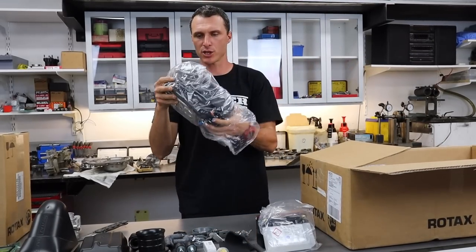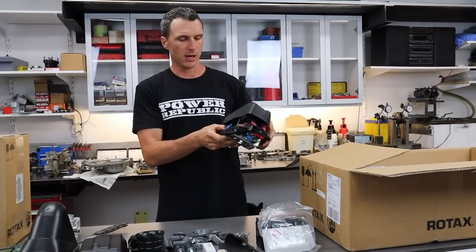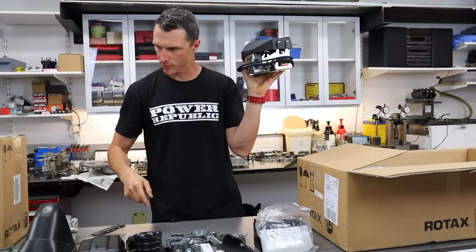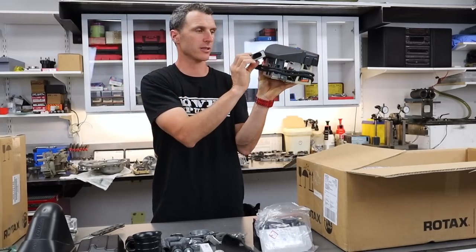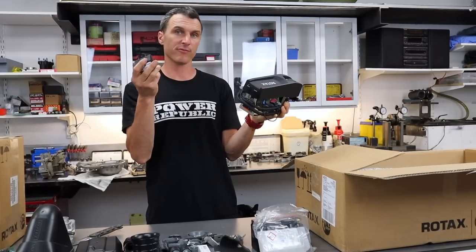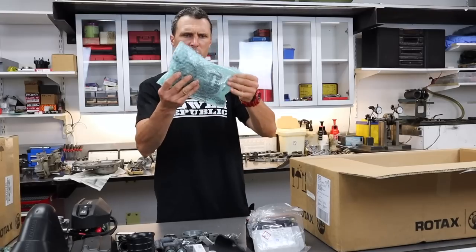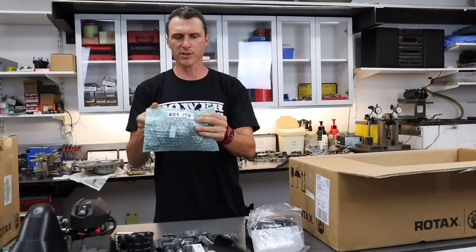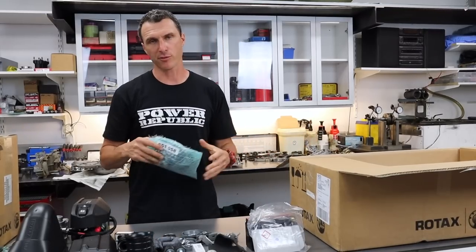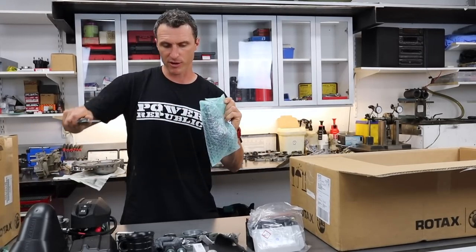This is the new EVO style battery bracket — it mounts over here on the left next to the seat. The battery obviously goes inside here and we mount the ECU here. This is the new anti-vibration mount developed by Rotax — a great idea that stops all the vibration and harmonics going through the electronics in the black box. In here is all the power valve components. They number all their parts, which makes reordering very easy — really top shelf system.